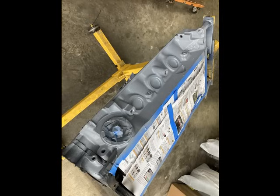This block that you see here is actually a 5 liter block out of either a 2000 or 2001 Ford Explorer. So basically the same block that we're working with Triple J. And as with all my builds, they always get the same amount of prep work and machine work. Baked and tumbled to clean them up. And then we pressure test those and Magnaflux the main saddles, that sort of thing. Bored and honed with torque plates. And the decks are squared up and the mains are cleaned up with the appropriate ARP fasteners.